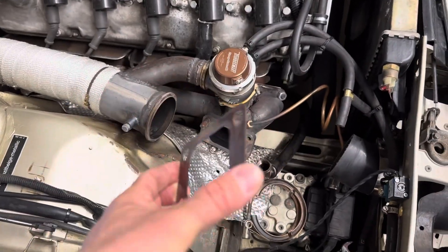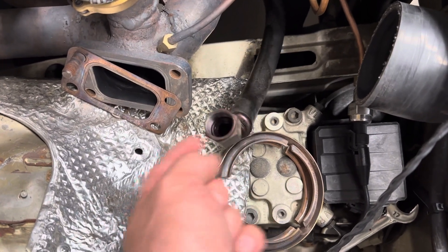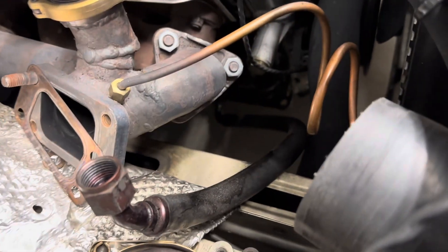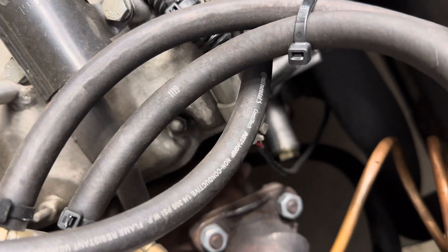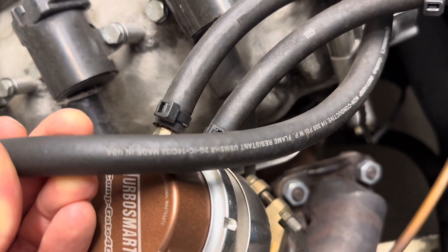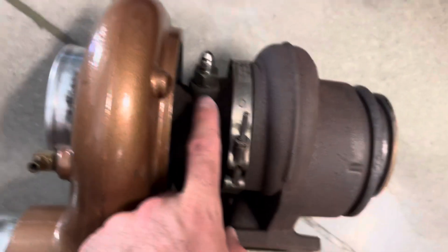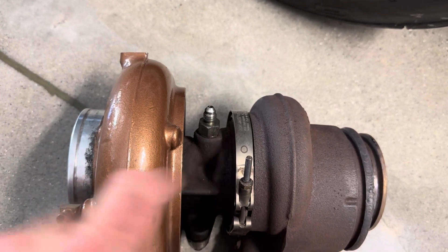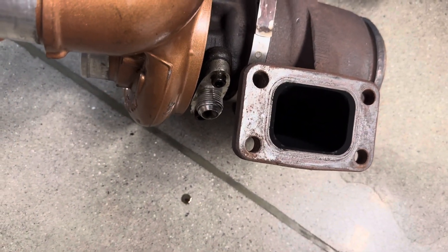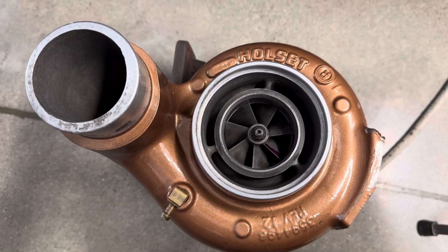There's a typical stainless steel flange gasket between the turbo and a dash-10 oil line that works really well, going down to the top of the oil pan. I just welded in a bung, and this is a dash-4 push lock — the Instagrip 300 is my favorite, but Parker push lock works too. This is quarter-inch with a quarter-inch JIC-to-barb flare fitting, and it's a metric straight thread with a gasket into a dash-4. So that's a dash-4 feed and dash-10 drain — in the most basic fashion, what it takes to make 550 wheel horsepower.